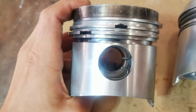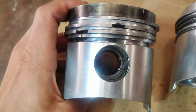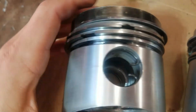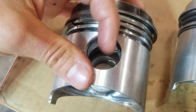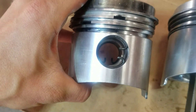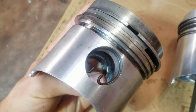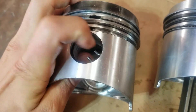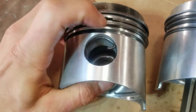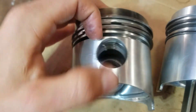Here's the old piston right here and you can see that's at like 3 o'clock. The thought process is: when that engine gets to going it's gonna compress it down this way and pop it off. Well, it's probably not going to, but it's better just to do it right because why not? And the circlip isn't gonna rotate in here like the rings are, so it's gonna stay put. You might as well put it at 6 or 12.